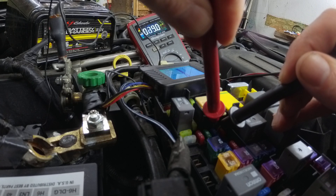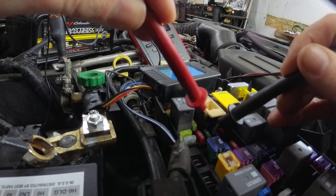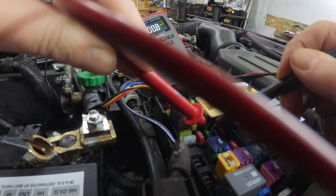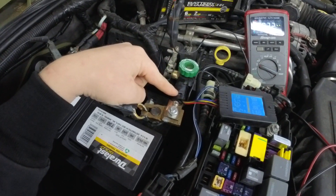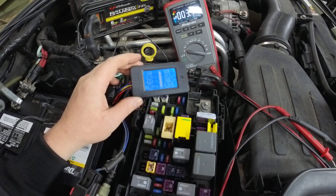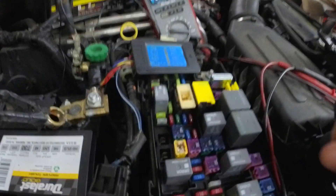Right here we have an active circuit. There are charts you can look up to figure out what 8 millivolts translates into. Essentially, a shunt works by measuring the voltage across a specific value resistor, and that resistance change gives you milliamps — or whatever unit it's programmed for.